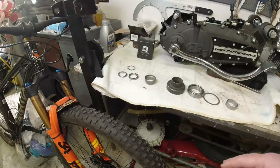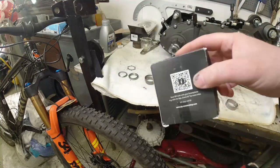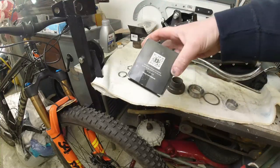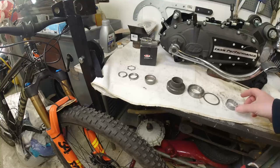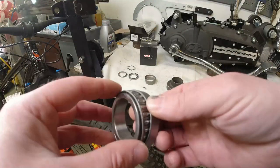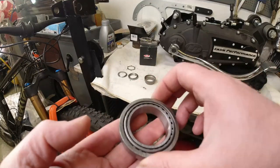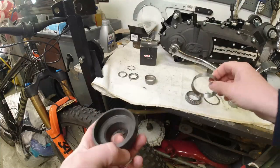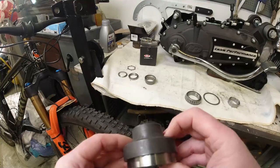So this is what I'm going to be fitting today. It comes delivered in this little box and it has a QR code on the back. I was thinking that's nice, SIP have made some instructions. But lo and behold, when you scan your phone on that, you just get the SIP website — absolutely no instructions whatsoever. What the kit comes with is this bearing race here, which you fit on your fork. It comes with the roller taper, which is sort of the star of the show. The race itself is a separate piece that you have to either peen or punch. It fits inside this cup here. This is the one for chrome ring scooters, which is 1964 and older.